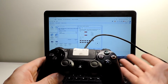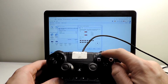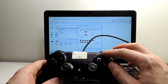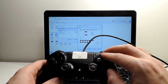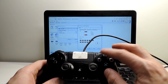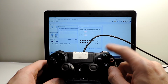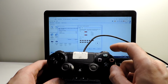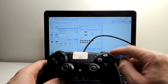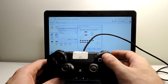So like I said in the beginning of the video, you have two options. You can just try to soak this with the IPA and hopefully it cleans it. In some cases, if just a very, very little liquid was spilled, then it should be fine to soak it and that's it. And as well, if you spill some kind of drink here, try to clean it right away, because if you leave it for longer, then it will dry up, and then it will get stuck, as you saw, in the socket of the button. So it will be stuck there, and then it will be much harder to clean.